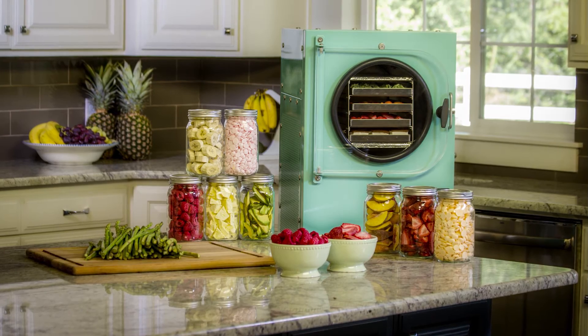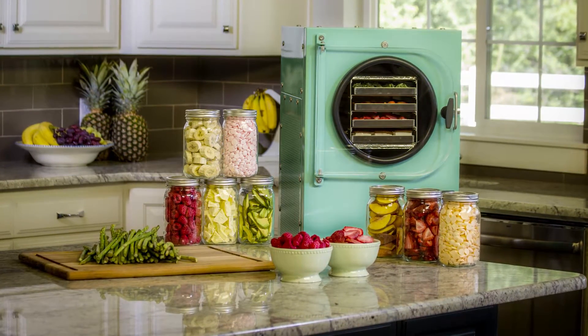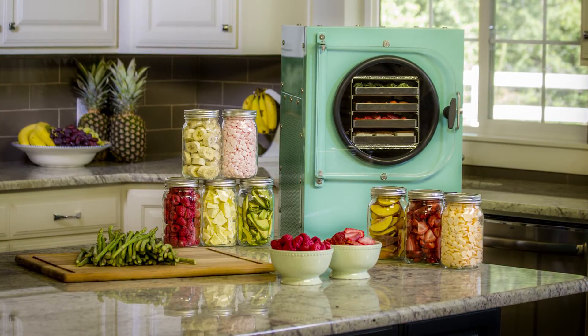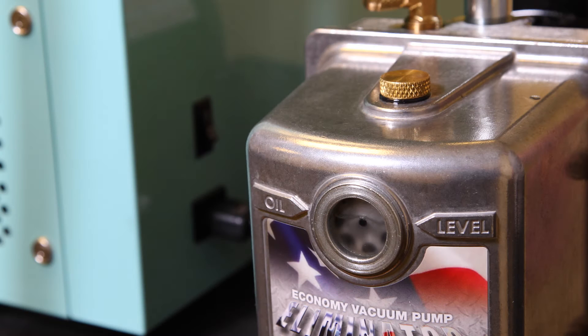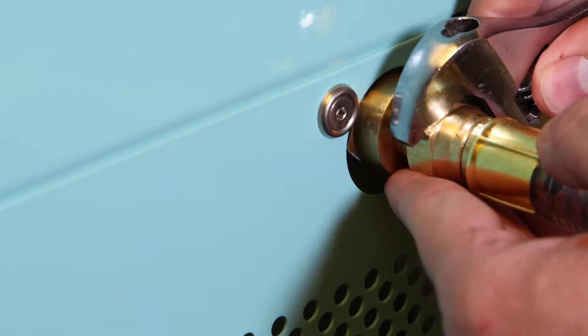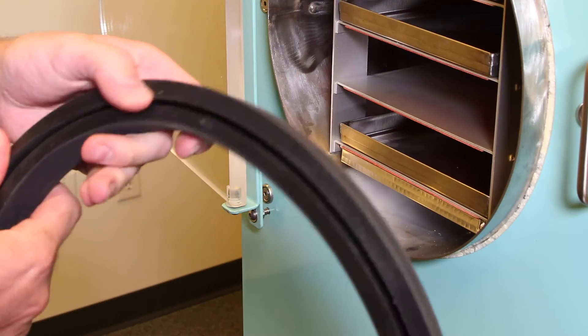This test is used in diagnosis to know if our pump, our oil, our vacuum hose, our gasket, and our drain hose are all functioning properly. To make sure we've got fresh oil, we've got the oil filled to the proper level, our vacuum hose is tight on both ends, our drain valve is closed all the way, and our door gasket is clean.